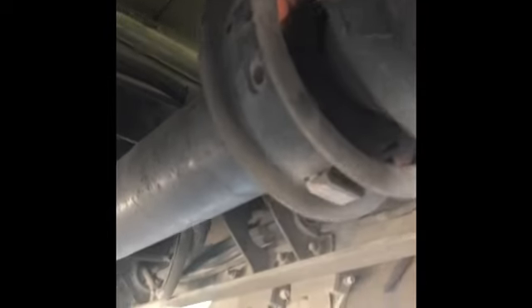We're up under the truck now. Step one: you're going to have to take your second drive shaft — there's your first one from the transmission to your hanger bearing, and then this second one goes from your hanger bearing to your front drive axle. We're going to take this one loose, and take a ratchet strap and pull it over to the frame and up out of the way. Then we take the hanger bearing loose — just two bolts, one on either side, mine are three-quarter inch bolts.